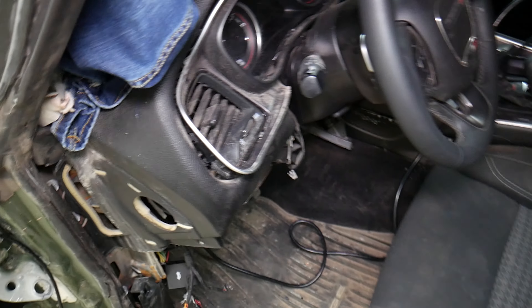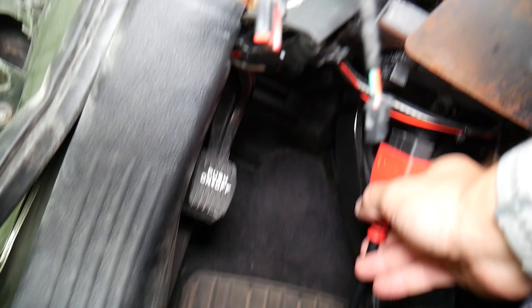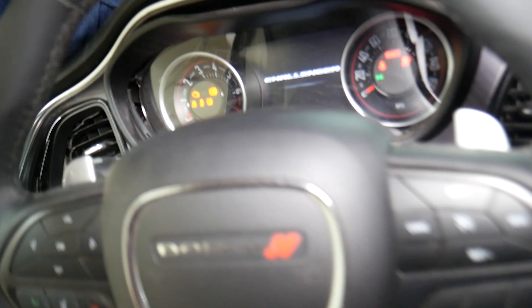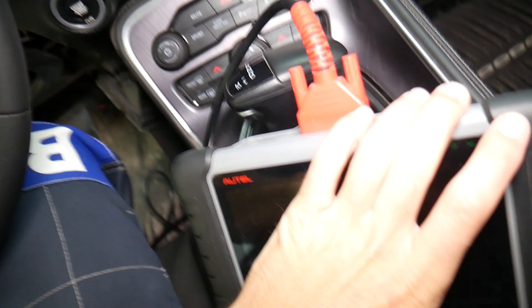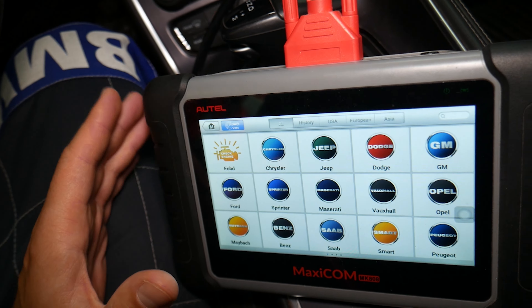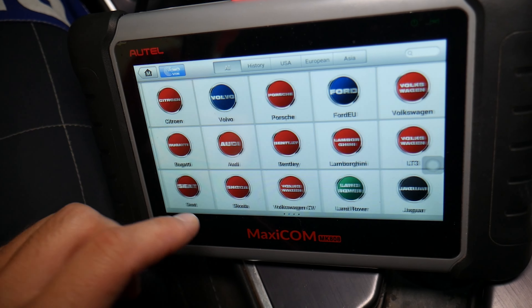The car was in a little bit of a fender bender — we'll be fixing it soon, not too bad. But it runs and drives like a champ. We have the OBD diagnostic tool connected to the port underneath the dash — you just go ahead and plug it in. We're going to turn the ignition switch to the on position. Press it twice without pressing the brake pedal; the lights will come on. Make sure the engine light comes on — that means you have communication with the tool.